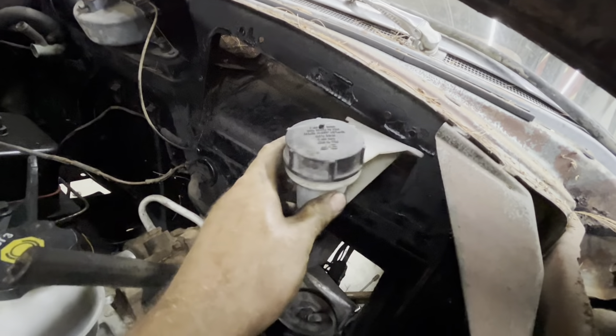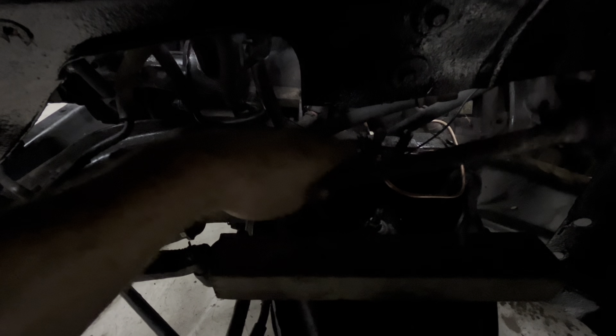I'm going to have to put a divot in one side that will accept my intermediate shaft. The intermediate shaft has a three-quarter round but with two flat spots and then one divot where the bolt goes through, so it won't ever come loose. Both sides are like that. It is collapsible, which is a safety precaution. I don't remember what I ordered it out of, but I'll try to look it up online and let you all know, because that one's pretty short and pretty universal — it'll work on any three-quarter inch shaft with a grinder.